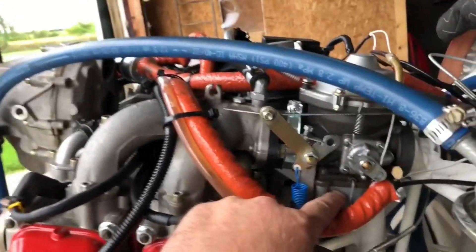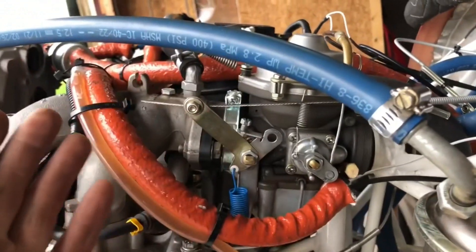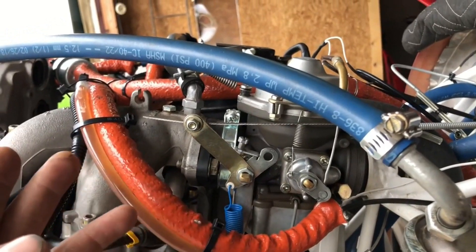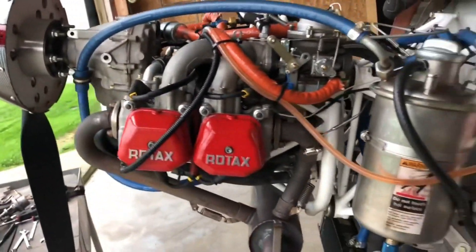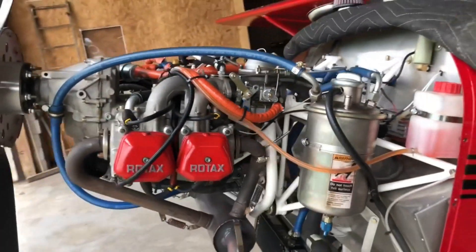What was happening is it was coming back up through there, back-feeding pressure into the carb bowl. Instead of just the venturi and jets pushing fuel through normally, I had pressure in there pushing gas in and flooding that side of the motor, making it run really rough. So I urge you to never even think about doing that.